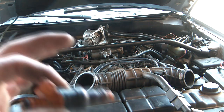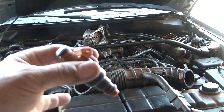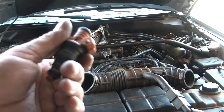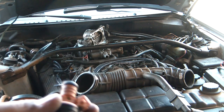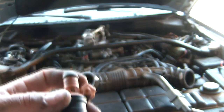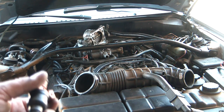In fact, when I put these in I'll show you — I'm just going to change two settings and this thing's going to run on the 30 pound injectors. They're like 1.58 times more fuel volume than the stock ones, so you have to compensate for that, and it's really easy to change with the tuning software.